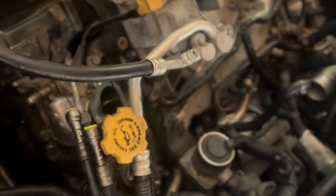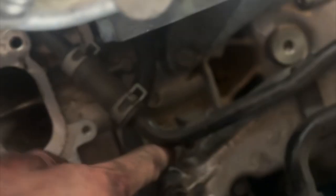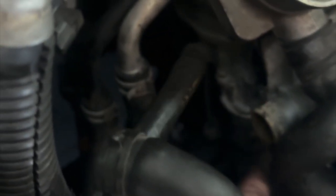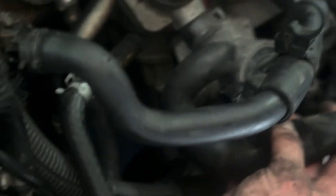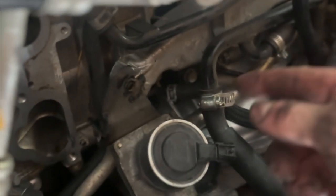To remove the air pumps, I started by taking off the bolt for the air pump motor, the bolt for the coolant crossover pipe, and that one as well so I can move it if needed. I took off two bolts — one here and one here on this motor — moved this bracket, then I'm going to take these two bolts off right there and right there to remove this motor so it's not at such an angle. Then I removed this part right here.